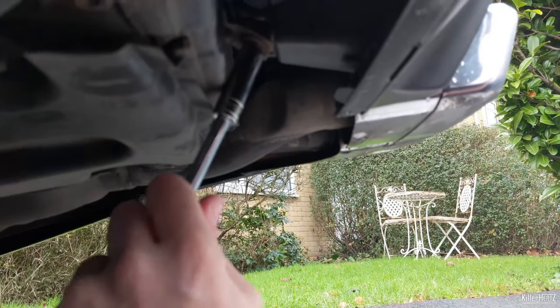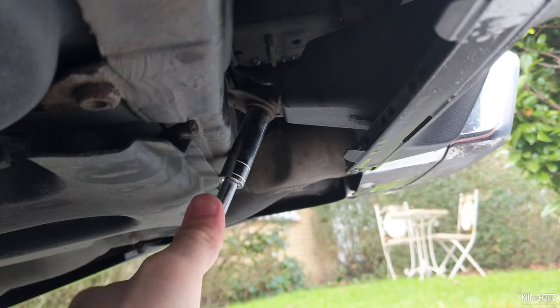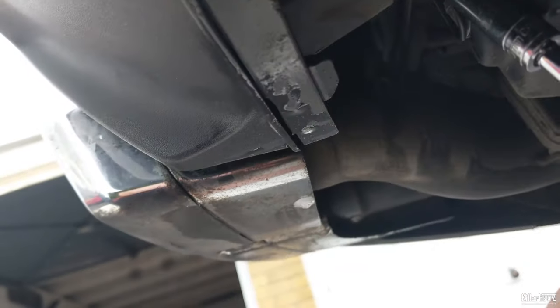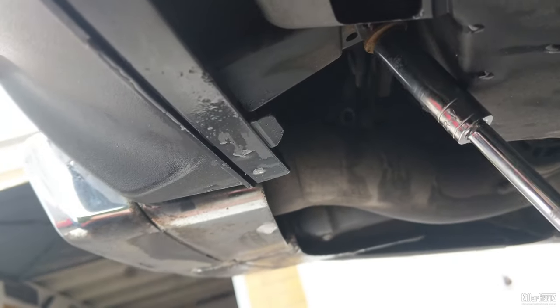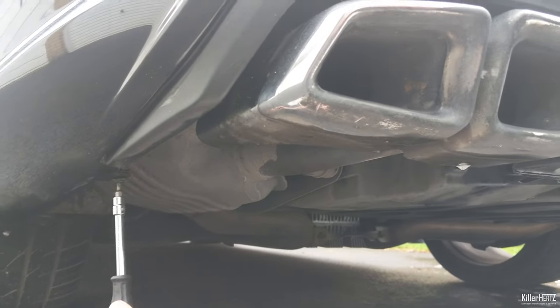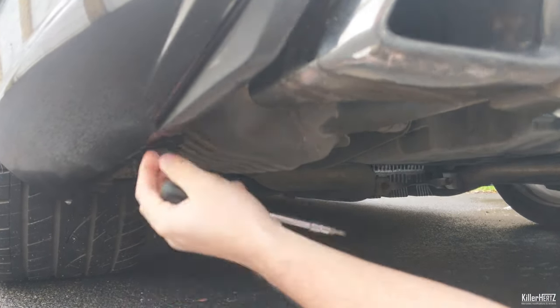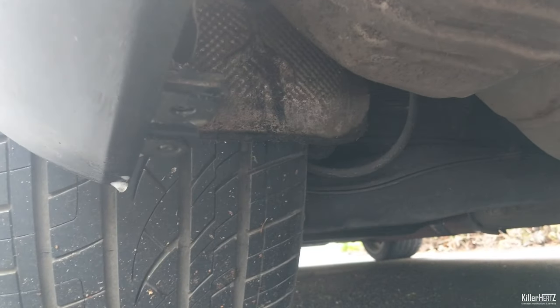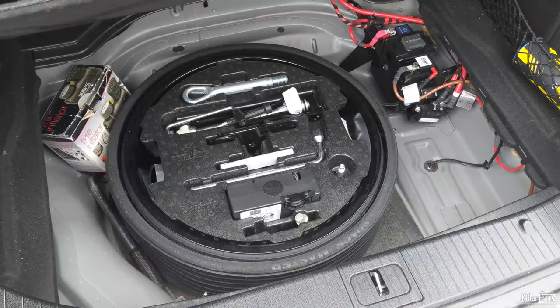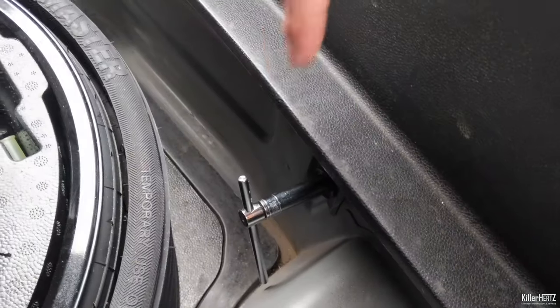Now it's about time I started to remove the rear bumper. First you're going to have to work your way around the underside undoing all the bolts. These are used to hold in the existing diffuser keeping it in place. As these bolts are exposed to the elements you may need to give them a spray of WD-40 if they don't budge. Then move around to inside the boot, removing first the plastic bolts holding the trim panel in place, which will expose the bolts holding the actual bumper on, on the left and right hand side.